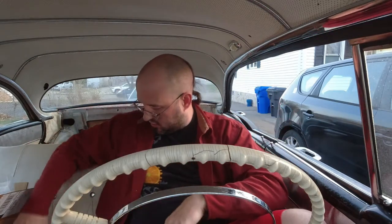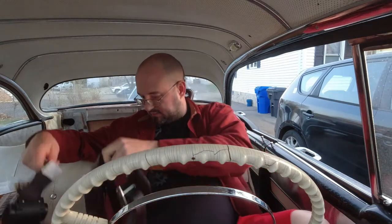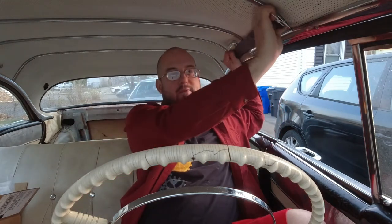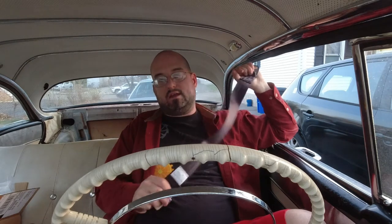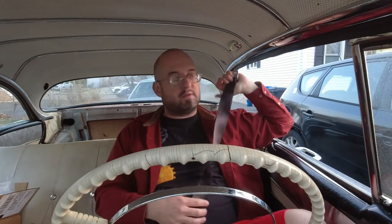GM in the early to mid 70s, when they had to put three-point belts in their cars and they were still selling hardtops, they had this same problem. The belt hanging down where it should basically made the rear seat inaccessible. So their solution was to have a very long piece, but even longer, up here, held in by two little clips — it actually had to fold back to fit in the clip because it came down most of the way. Then that would hang down, and you'd have a manual seat belt that it would click into, and you'd have to pull it tight. They didn't work well — either it just stayed in those clips and nobody used it, they used the lap belt, or this just kind of hung down awkwardly, got caught in the door, fell out the window. And if you drove without the belt on and the windows down, it would fly all over the place.